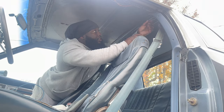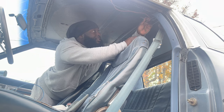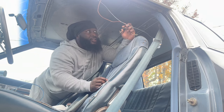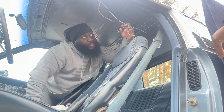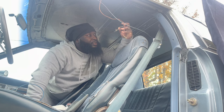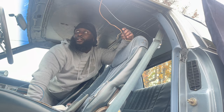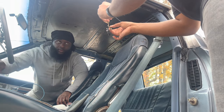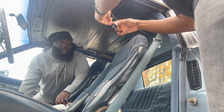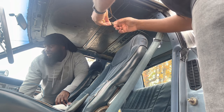This boy got a TV in that, ain't it? Everybody else do. Hey. I don't think this got no power to it, does it? Oh yeah, you need to take them up. Yeah, because I don't want that. Those are hot wires. That orange one, that's an always hot. The tape right here, bro. Oh yeah, electrical tape, go ahead. Yeah. They're light too. The always hot is covered, but still won't hurt. Well, I always said that because it's gonna be on the roof of the car. Yeah, it still won't hurt to tie this up.